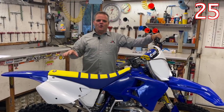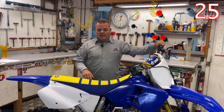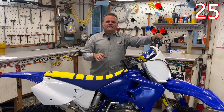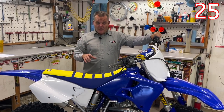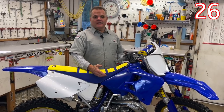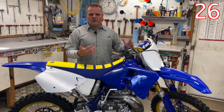As you're going over the bike, inspect to make sure there are no other missing components that are unattainable. Air boxes, air boots, and the intakes into the engine are all pieces that are getting harder and harder to find because they've dried out and aren't available from the OEM. To go along with the new plastic is graphics — you can have simple retro-style graphics, or in our case Decal Works is making us a full kit to go along with all the companies we worked with for this build.